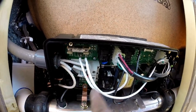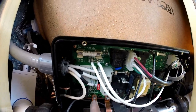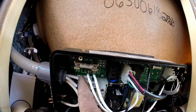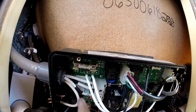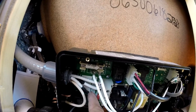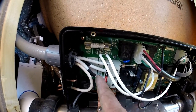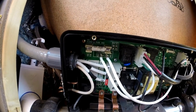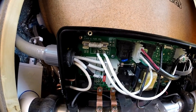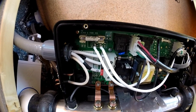Use a 3/8 wrench and a 1/4 inch wrench underneath the brass or copper part. I've hooked up the common wire on top, the hot wire here and here, and the ground here. I personally would never wire a hot tub like this — I would always run the ground in green and the common wire in white. I would have left these just black so you would know which way they go, but that's just my opinion.